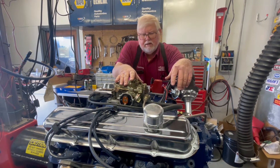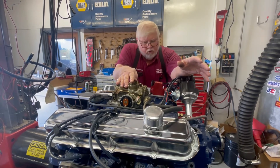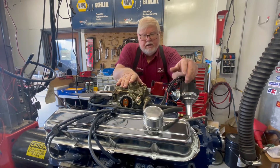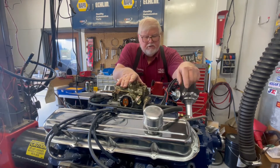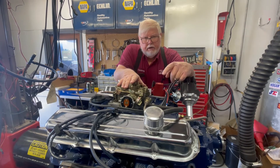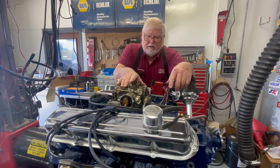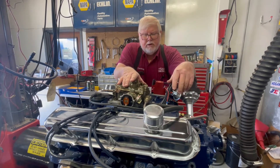The reason these kind of went by the wayside was with the advent of catalytic converters. Catalytic converters get really hot, and when you start pumping more air into there with more burn, they generally get hotter yet. So they started restricting how much air is going through there, and with other engine controls, they figured out how they could turn them on and off.